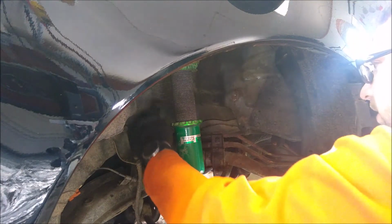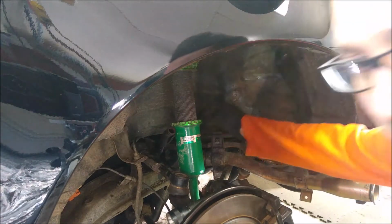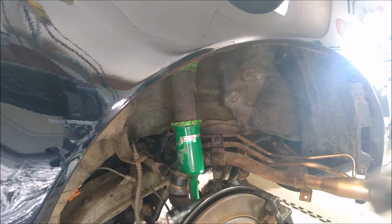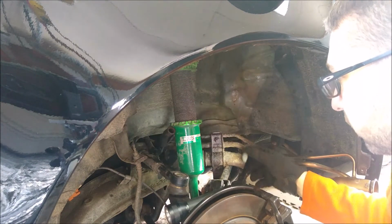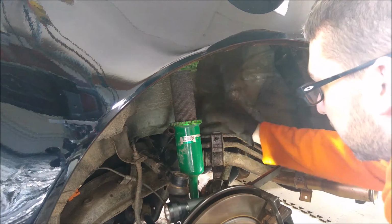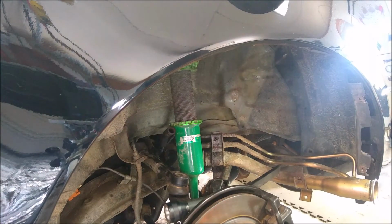2 of the 3 hoses off. What you can see is going on there is that we have a lot of buildup right around the part where the hose connects in. The rust jacking that occurs in the Northeast actually makes it very difficult for hoses to come off once they come on, because the metal swells and then it tightens that rubber up even more. So that's the large problem that we're fighting right here.